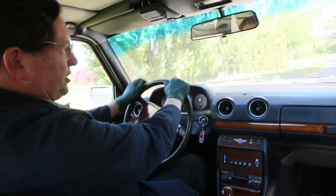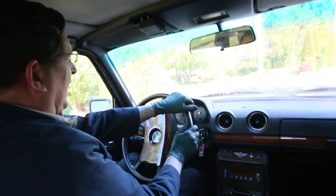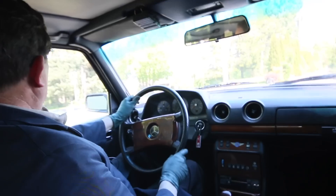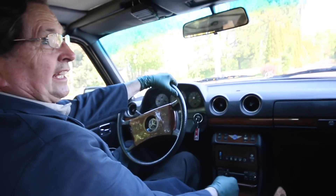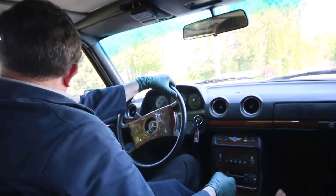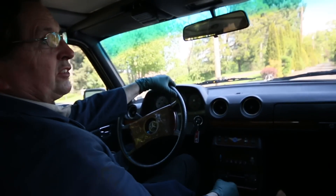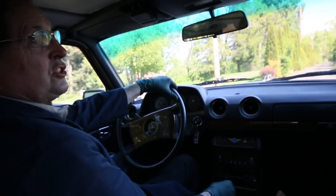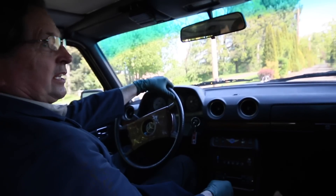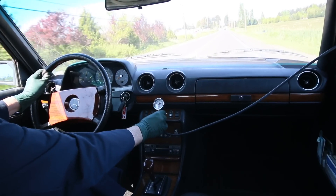First I want to make sure the turbocharger is producing boost pressure. If it's not, then I've got to tackle the turbo. But if the turbo is working okay and I'm getting at least eight or nine PSI of boost under load, I can go after the overboost circuit and the ALDA, along with the banjo bolt that can often get plugged and gives positive pressure to the ALDA.